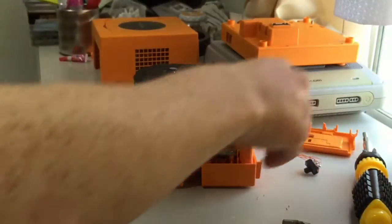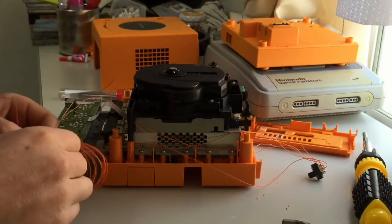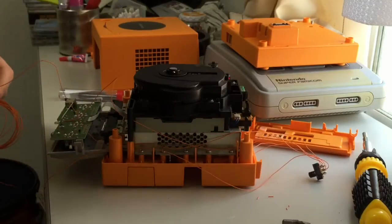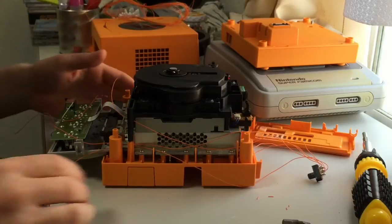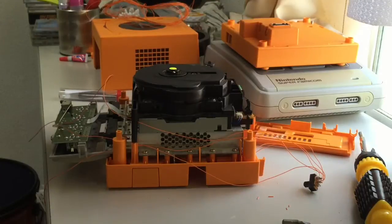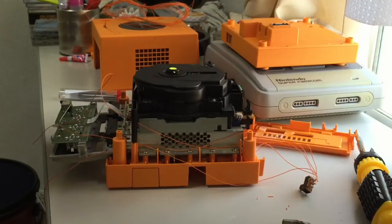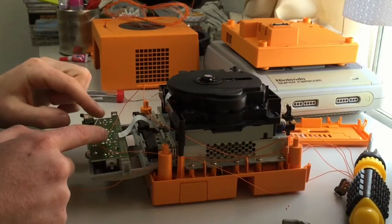Make sure the switch can go around. Obviously, I need to super glue that switch back into position, but it's all right for this video, just to show you how this is done. So I'm happy with that, so just going to cut it. So now you've got your 3 cables coming from one row of this switch. So one goes from the positive hole to the center of this double pole, double throw switch. Now the other 2 go from each anode, basically. So from each leg they'll go.